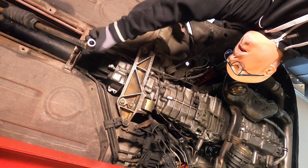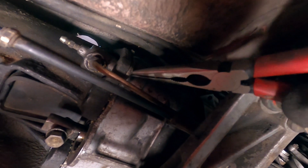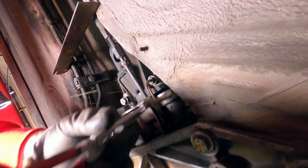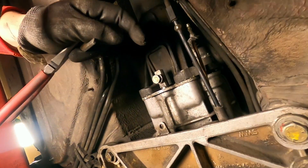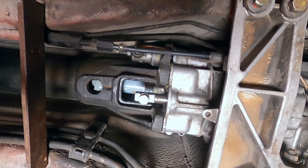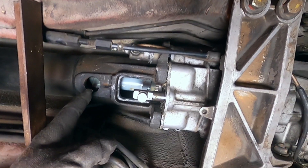What this does is when you lower down the engine and transmission, the shaft won't fall down. For the actuating cylinder here, there's a little bolt just here. When you take that out, you should be able to — there you go. This is the little holding bracket. As soon as you have this one out, you can wiggle this cylinder out as well. You won't be able to take it out completely, but you can just loosen it, and as soon as this comes down, you can just take it gently out of the way and leave it in the car. Another very important piece is to get the little spline bushing between the gearbox and the torque tube off.